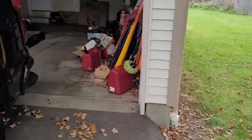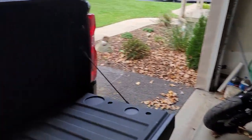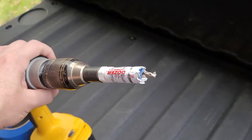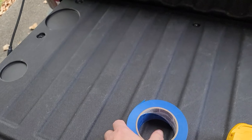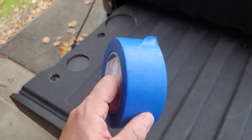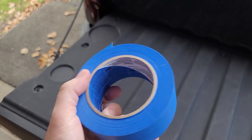What I used to install the new antenna is a typical NMO mount, so I just went and got the hole saw for that — pretty easy. Then I just pre-taped a good 10-inch square on top of the roof with about three layers of paint tape just to help with any scratching or debris, and the hole actually came out pretty good.